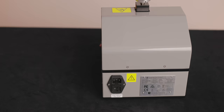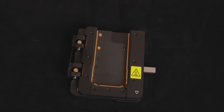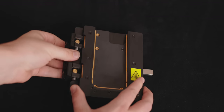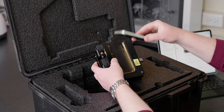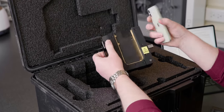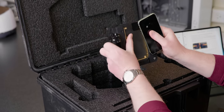This is the actual heating element tray where we insert the phone and it heats up the sides to loosen the adhesive around the display. This is in contrast to a lot of aftermarket stuff where you put the display face down and it just heats up the whole display. I'm assuming this is more targeted heating for the actual adhesive, so that's cool.